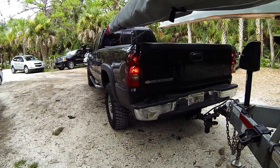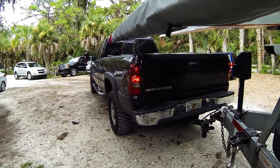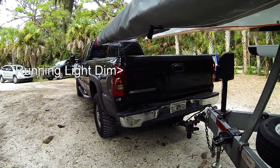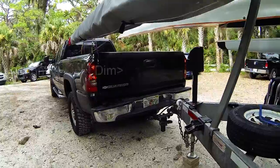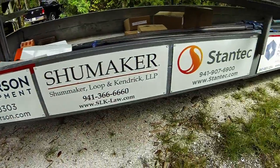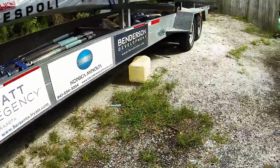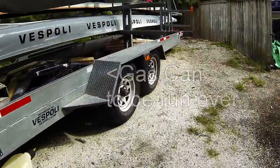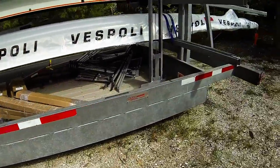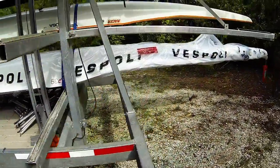It's important to differentiate between the running lights and the brake lights — running lights dim, brake lights bright when you press on the brake pedal. Walking to the back and checking our running lights, our yellow running lights on the side look good up front. The yellow running light here looks like it's working, but the turn signal function is not working — the left turn signal function on the trailer is not working for some reason.